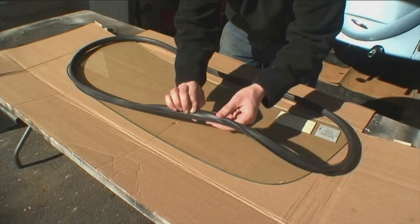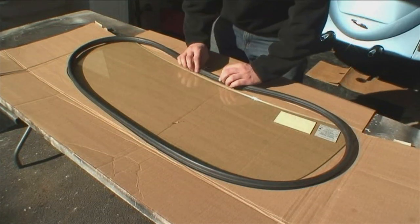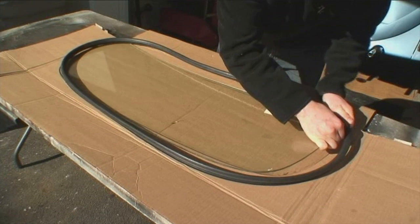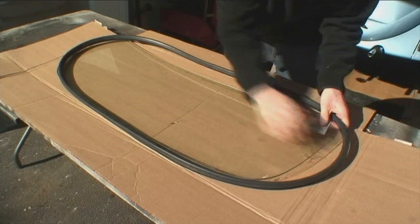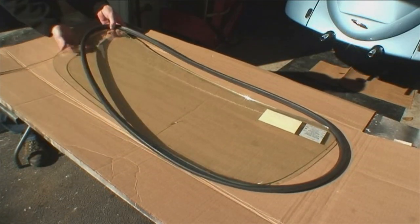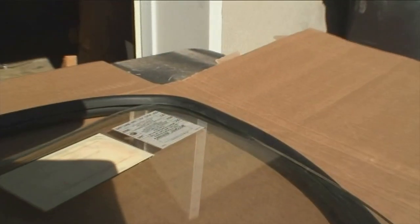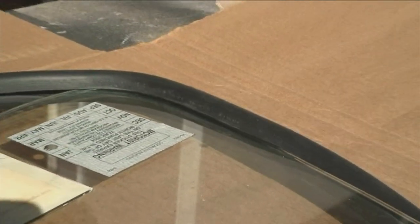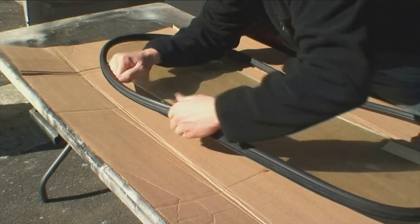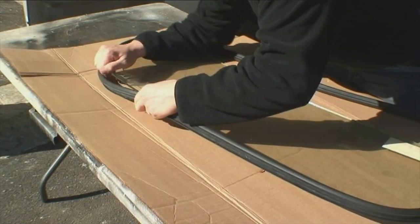I'm working in an outside area so the sun is beating on the seal and it's nice and soft. What I'm showing you here is part of the seal where the grooves are. The flat portion of the seal with the groove is what will go around the window; the other groove is for the chrome, which you'll notice is on the outer flap. You want to make sure you're getting it on correctly. Just keep working it upward and around — I started in the corner. It's a lot easier when you're out in the sun because the sun is warming the seal and makes it softer.